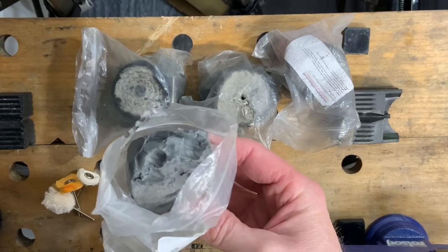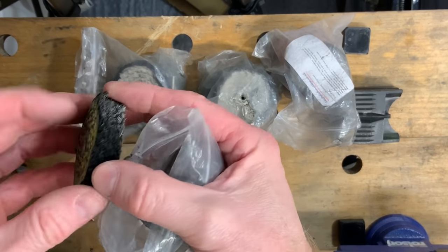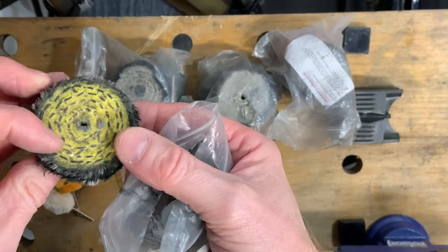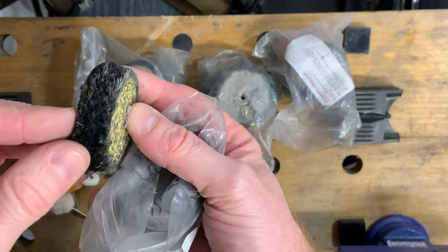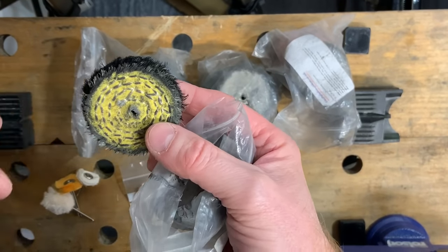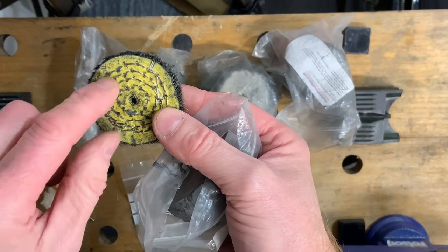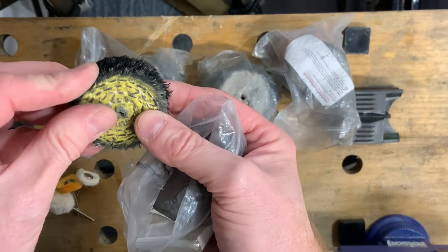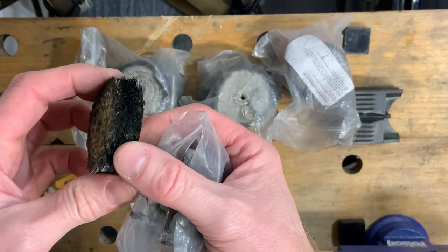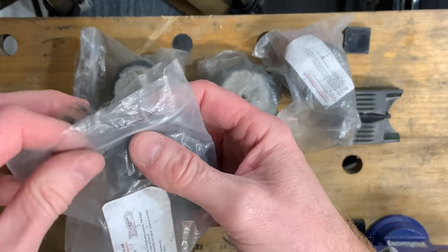It's all very dark, and if you're using a polishing machine, which I've got a little bench grinder, you'd use a wheel not dissimilar to this, which is called a sisal, which is made out of fiber. I can't remember the plant this is made out of, but if any of you play darts, it's a dartboard material. That's basically what that is, and it's stitched together to keep it tough, and this gets under quite a lot of scratches actually. It's very abrasive, but couple that with the compound itself.